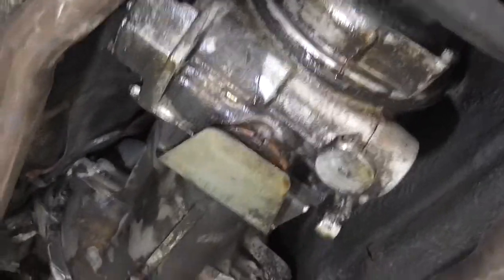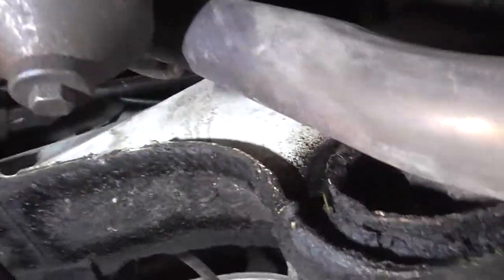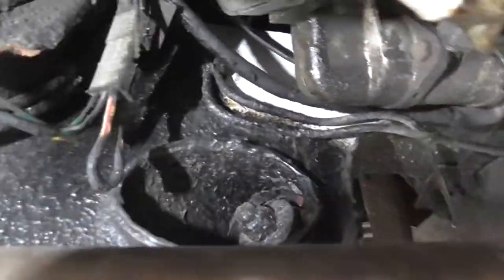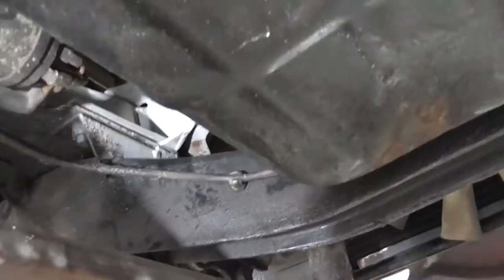Going up in the centre of the car, now just going over the transmission — a little bit oily in places, there's nothing too drastic. The sump, oil filter. If you're looking up there on the inner strut leg there, you'll see the original white paintwork above the under seal. And the same on the other side — although it looks a bit fresh, that under seal, but I'm not sure if it is or not. It's the same texture — it's maybe just got a bit of oil on it over the years.